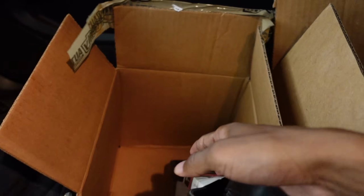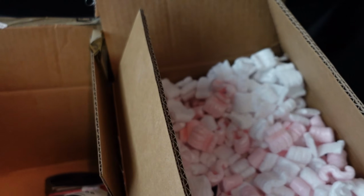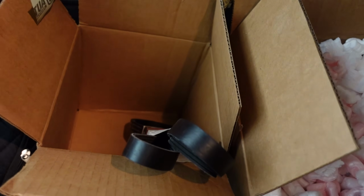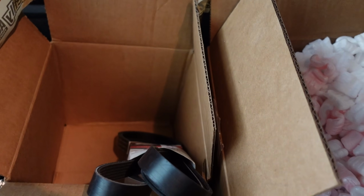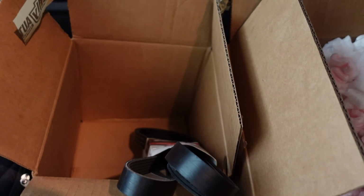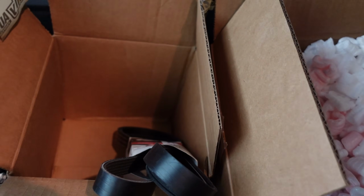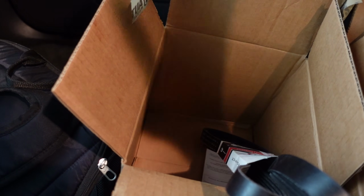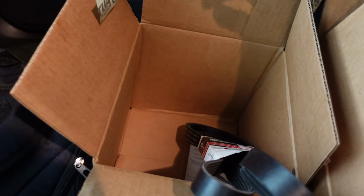and this lasted quite literally over a year. So I'm gonna go ahead and get this swapped out, and I do have a brand new alternator in here. This is gonna be actually a 130. I don't need to get a 200 amp alternator. I found that out. So we got a 130 amp alternator in here. I'm gonna go get this swapped out. Figured that probably best to do this at the same time because the belt has to come off to do the alternator, so it's just going to be hopefully a quick swap with the new alternator as well as the belt. I'm going to get the old alternator that's on the car right now tested, because I actually never got it tested, but I'm under the assumption that it's literally about to die, considering the fact that the car quite literally wants to shut off at high RPMs.